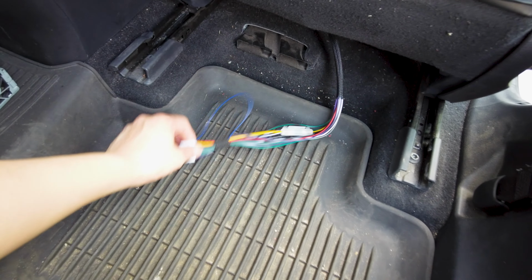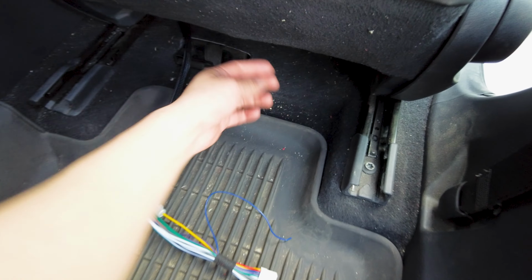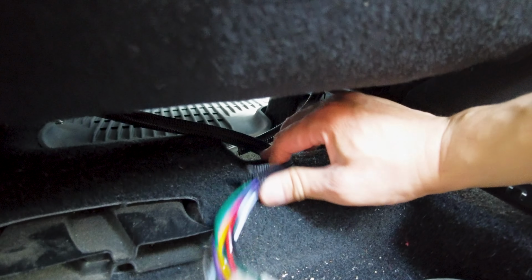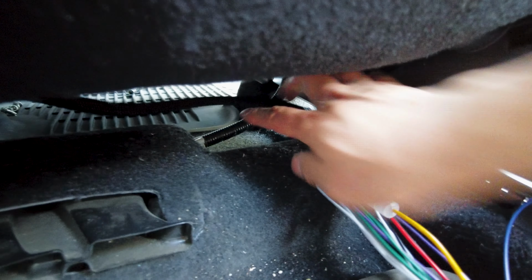So it's here now. And all we have to do is connect our DSP amplifier, add some Velcro tape, and mount it. I'm gonna mount it right here, right above this vent. It should stay put, and we'll organize the excess cable and zip tie it to this factory wire loom on the right.